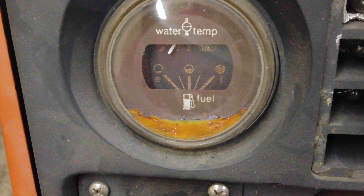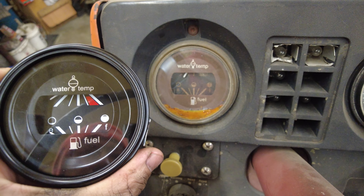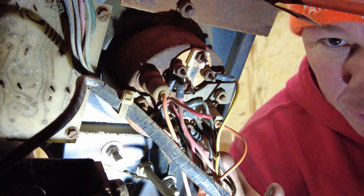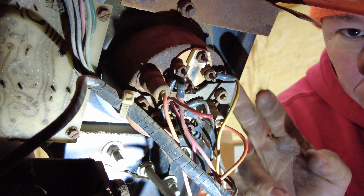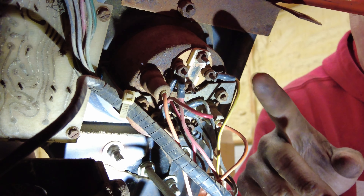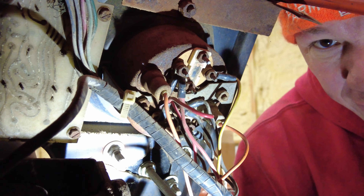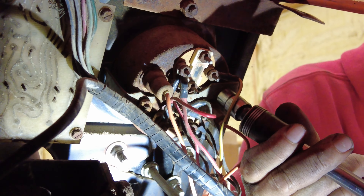Moving on to the last little update. Right there I don't like that because that means it's a gauge that's not functioning. We have a solution — we're going to replace that. Pretty simple: once we get back here all we're going to do is take this bracket that holds it on, take that off, and then we're going to disconnect these wires. But I've got video in my case so I'll have proof of what goes where. If you're not videoing it, make sure you take a picture before you take it all apart so you can reference it.